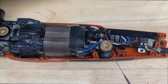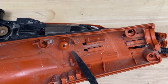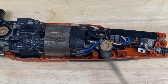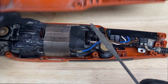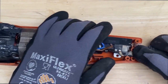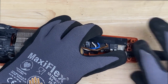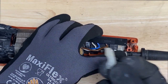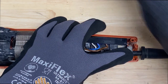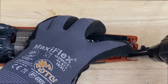Now you'll notice that there's these little round donut pads here, and then there's a nub right here on your housing. That's going to line up right into here. So if something isn't fitting, then you need to pull this back off and check it out. So one thing we need to do is we need to get our extension cord, the power cord back together, get the clip that it holds, the little C-clip here, along with the screw. We'll get that back on.